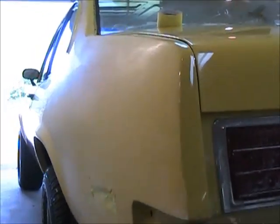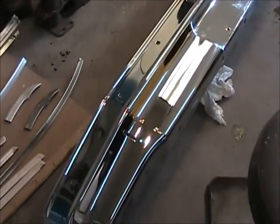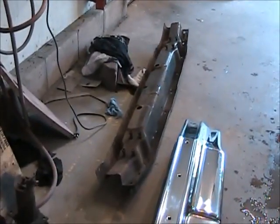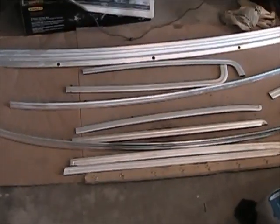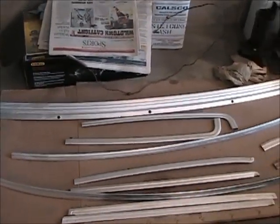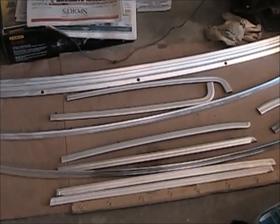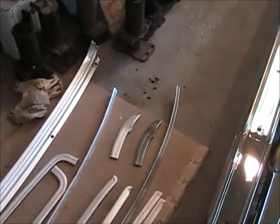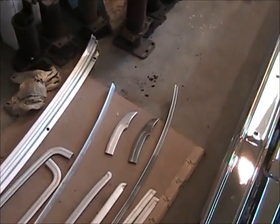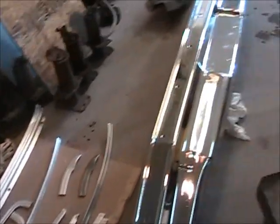I've been lining things up to do when I get home at night - going to spend an hour out here every night. Got the front bumper out here - going to polish it up some more. Got the front bumper bracket which needs cleaned up, it's really greasy. Got the chrome - the aluminum trim - all anodized off with the Drano, which worked really good. Got some sanding to do there. Sherry actually did one piece. It's going to take some work so maybe do a couple pieces a night, eventually get her done.